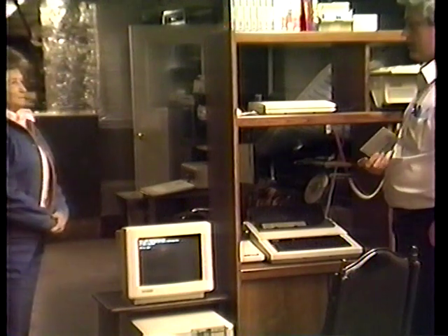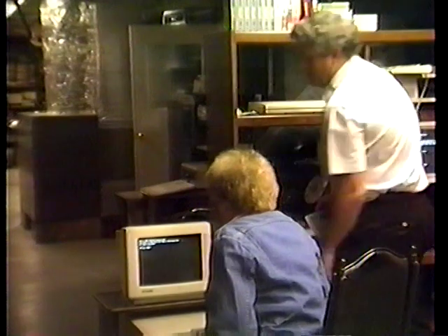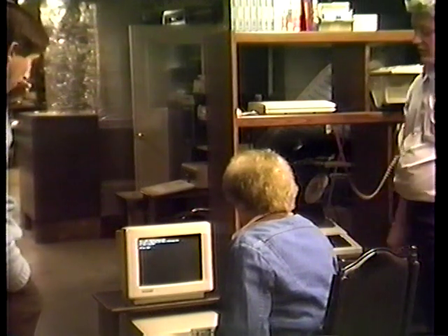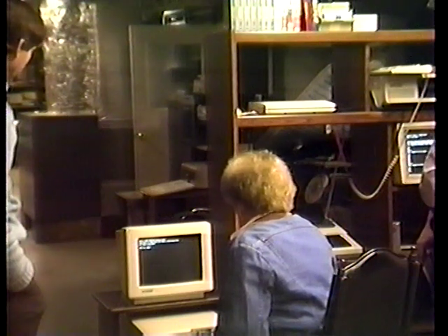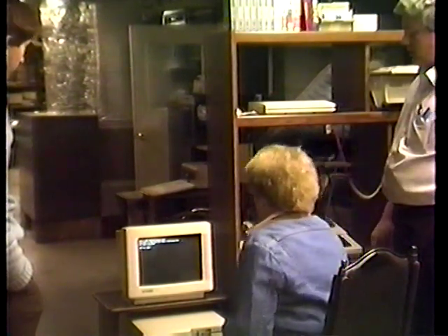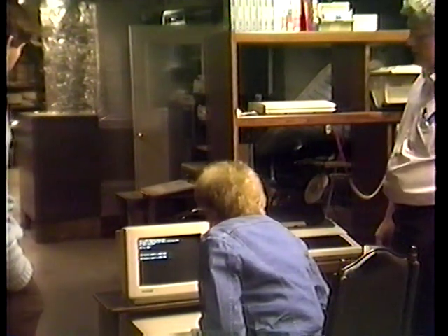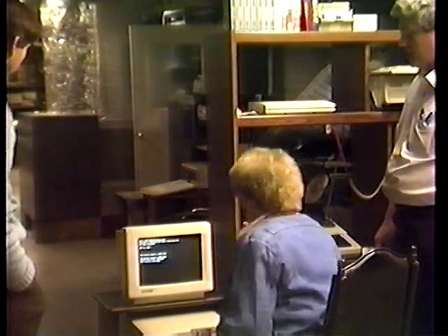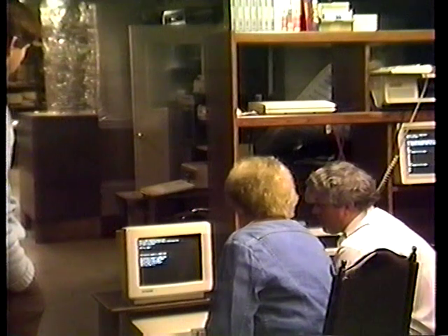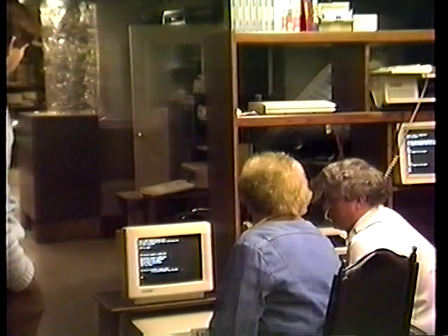Floppy. Okay, we're going to put it in real quick before it accesses. Right now it's not accessed — it hasn't lit up the light. We've got it in time because it's still going through the system. Otherwise we wouldn't have had time. So by putting that in there it's going to short-change it from going to the hard disk at all — it's going to go to this floppy and you'll see it now boot from the floppy. That was a system operating disk. It's reading it now. It will not go to the hard disk. Now it's asking for time and date. If you don't have any time and date in it because it's a system disk — not all systems have system disks, but this one does. Now if you want a list of directories, you type DIR and see what file domains are.